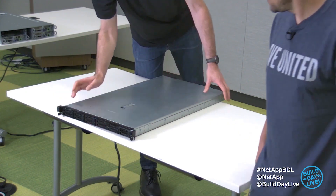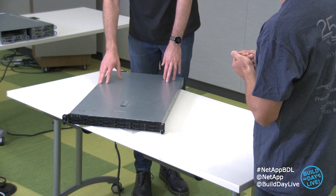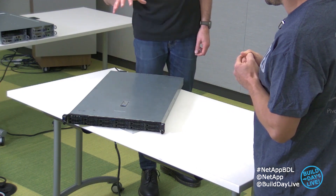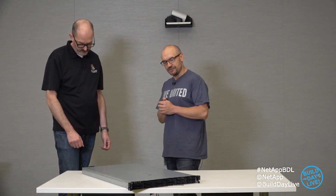So this is a 1U enclosure — really small, really compact. Have you previously used 1U enclosures for the HCI products? The answer is no. We have used it previously for the SolidFire product, but not specifically for HCI. So this is the first generation where we have introduced full-width 1U nodes. We've got drive bays at the front — the usual 2.5-inch drive bays that will be all-flash if these are storage nodes, and empty if they're compute nodes. We get 12 slots that we can populate with different drives on the front.